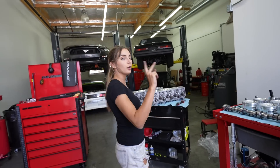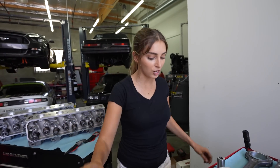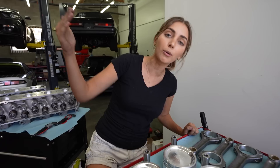There were two things preventing us from hitting 2,000 horsepower last time. One was the compression ratio — it was too high. We could have compensated with gasoline, but thanks to Tron Pistons — and shoutout to PFI Speed for connecting us — we now have deeper dished pistons to lower the compression ratio, which means more boost.